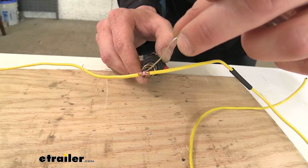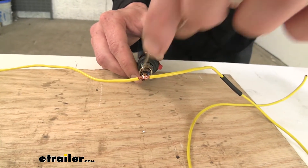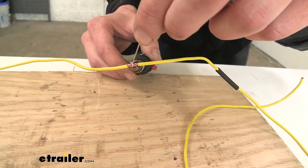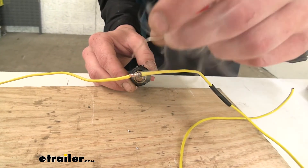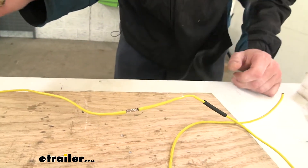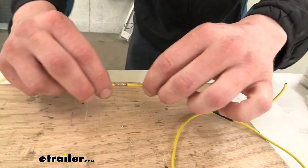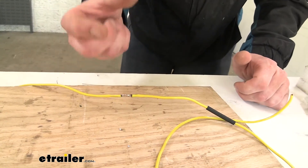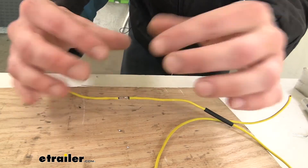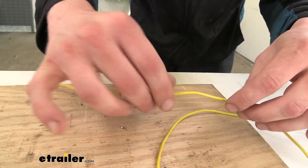Some solders do have certain amounts of flux in them to help assist with this. Depending on the gauge of your wire it may take longer to get enough heat into it, so if that's the case just turn up the heat a little bit more. There we go — you can see now that touching the solder to the wire it's melting right on the wire, drawing in between each strand to ensure a nice solid connection with very low resistance. That's one of the issues with butt connectors: they're a quick easy repair and you can get heat shrink ones to seal them, but you're just squeezing metal over wire, which leaves a chance for small resistance to build up at all those connection points. This solder repair is going to reduce the amount of resistance in the wire.